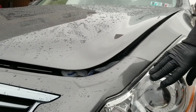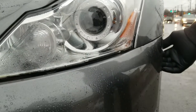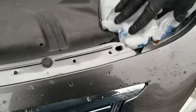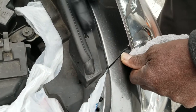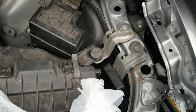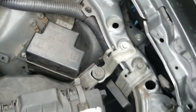In order to pull this light out, you have to disconnect the bumper cover, which is basically one screw here, and then you have a couple of fasteners underneath and up in here under the hood. I'll tell you later on why this plastic bag is here. Under the hood, you have to reach in — there's a screw going in through here from this direction. You have to go in there and undo that screw. And there's another hookup right in here. You have to move this to get to the screw down in here, and then I believe there's another one underneath from the bottom.